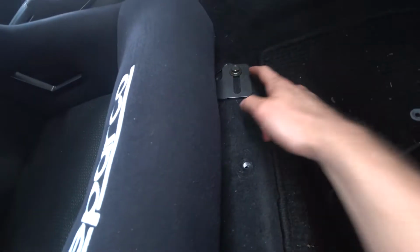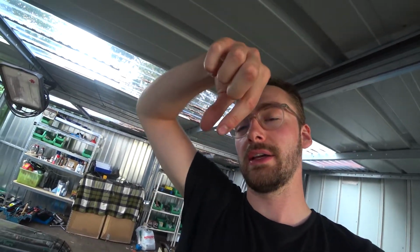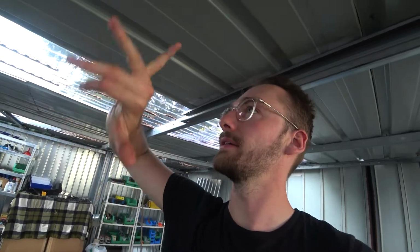Okay, now the seat screws are in. Screw here, screw there, all the way tightened down, and if you lift that up, you can see there is a screw. And right there as well. These Taibo seat rails, I don't know what they did there, but you need to push them down really hard just to make them fit over the holes, and you don't tighten the bolts in correctly. Like the thread's not going in, anyways.